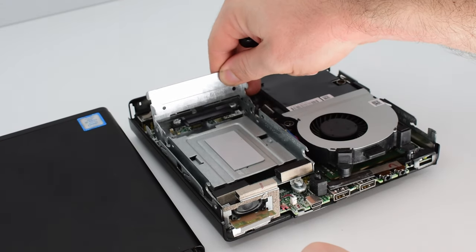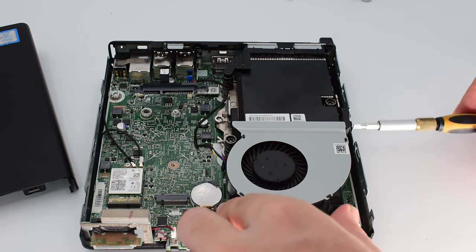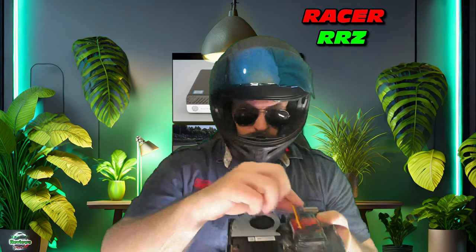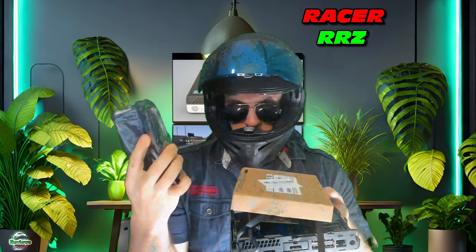Mini PC showcase - very straightforward to upgrade these little mini PCs. One little tab at the back, the cover comes off. Here's our current unit with the SSD - I've removed the SSD bracket for better viewing. We're going to strip this apart and really tune it up. We'll temporarily remove the fan to install the RAM modules, the SSD comes out, and we fit all the extra adapters. The flex I/O gets replaced with the 2.5 gigabit NIC, we throw in the RAM, add power, fit the 10 gigabit card with the x16 and x8 PCIe adapters, and there it is - a server mini PC.